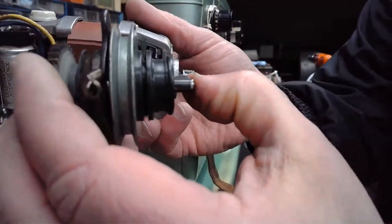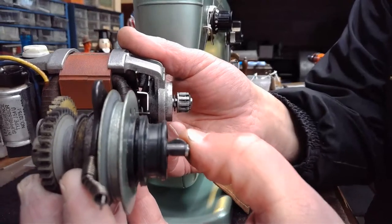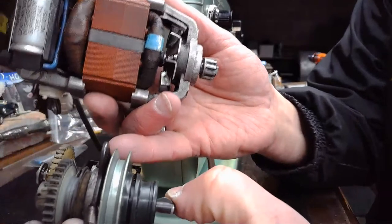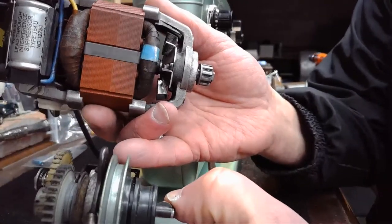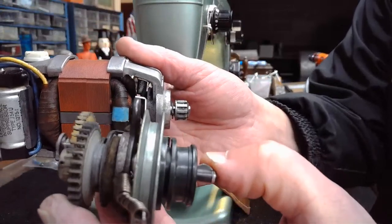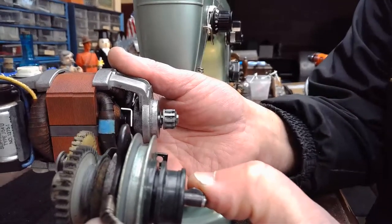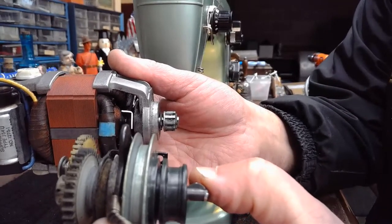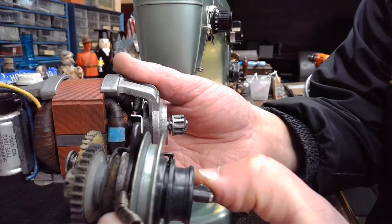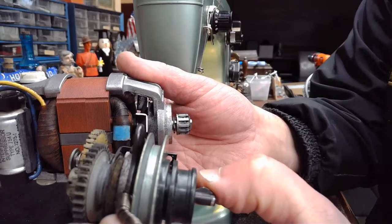This is kind of how they're going to be lined up inside of the machine. And this will be pitching a little bit because of the failure of that rubber boot. And then it's going to cause very rapid wear on that belt. It's going to be running not true from this pulley to this pulley, and it's going to result in that belt prematurely wearing. It's also going to create a lot of strain on the motor too, because it's creating drag and resistance. And that motor is having to work a lot harder to try to compensate for that.